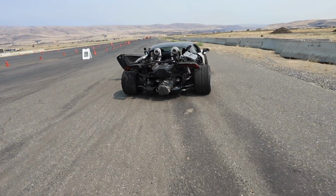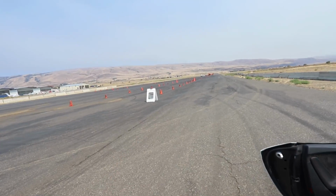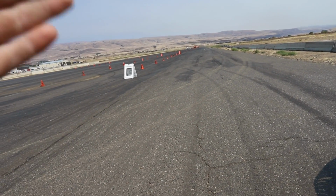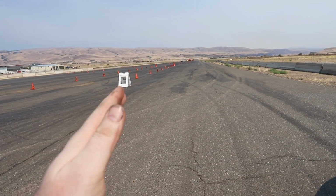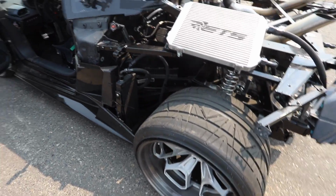That was interesting. It was great to get to drive the car around a little bit. That was no throttle in any gear really. What's happening is around the long sweeping bends, the car is bucking. I'm thinking it's fuel starvation. It's almost like it's starving the engine, and then as soon as it gets its fuel back, it's giving it to us and smashing it through. So it feels insane because once it picks back up, it really picks up.